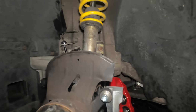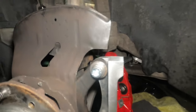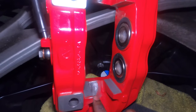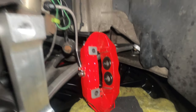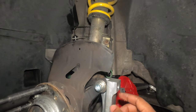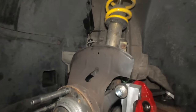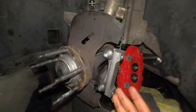This is day three. I found the solution — Freaky Part helped me find it. It seems I was installing the bracket wrong, and this is what created the fitment issue. After installing the bracket correctly, I test fit it and found I did not have to do any of the modifications I had done on the calipers — including the shaving. If you install the bracket the right way, you will not have to do that. I was following a build journal where someone used the exact same calipers but a different bracket, and I was mounting it upside down. After I contacted Freaky Part, they showed me a picture of how it's supposed to be mounted, and as soon as I mounted it correctly, everything was good. It's great that I made this video so that people who purchase the kit from them will know the right way to install it.